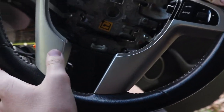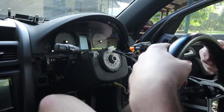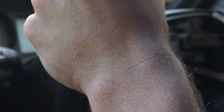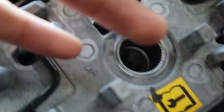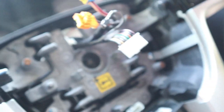We fixed the little problem — just basically give it a yanky yank, replaced that bit with a new bit. Once you've decided you're going with an aftermarket no-airbag steering wheel, stick everything back on through. All those wires go through the little hole at the top. You want to line up this spinning piece — make sure it's at the top because that's where it's going to go. We're trying to line up this little line here with the line inside — when those lines line up, we have a straight steering wheel.